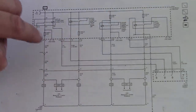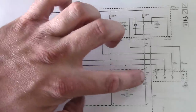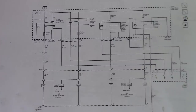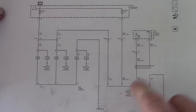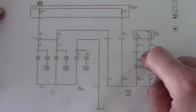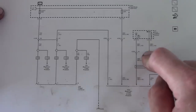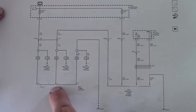There's one wire for the marker lights, left turn, right turn, and the backup lights. It would appear we have the same thing for the brake controller — underneath the dash there should be some more blunt cut wires. One's going to come from the BOO — the brake on/off switch — and fused power, and then there should be one that runs all the way back here for the brakes, another one that's just power all the time, and a ground. So if I'm reading this right, we should not have to run any new wires.